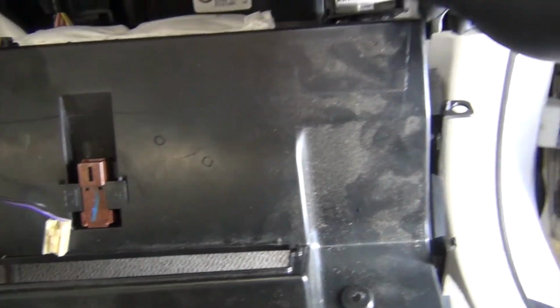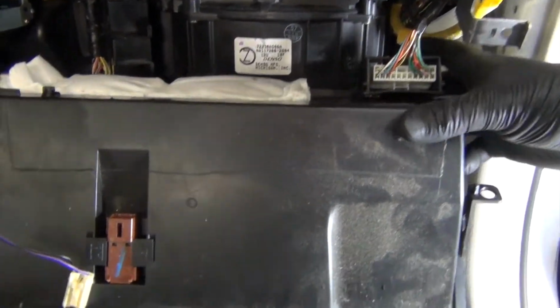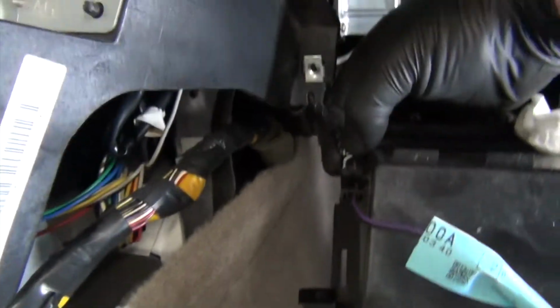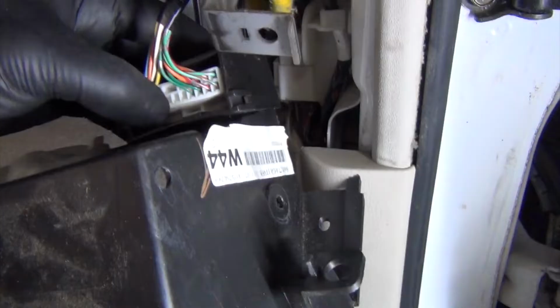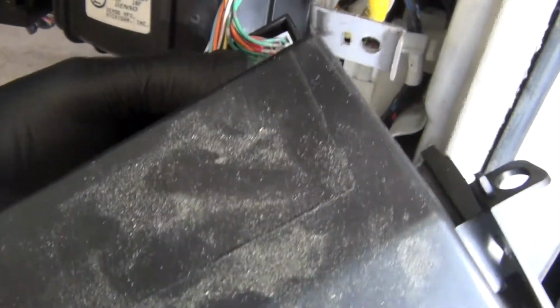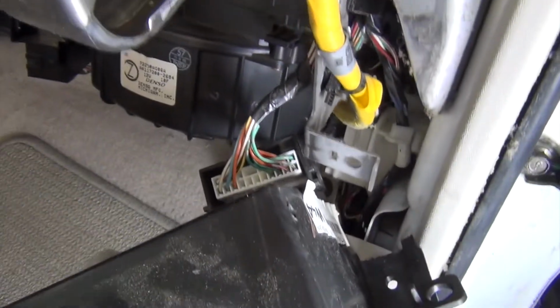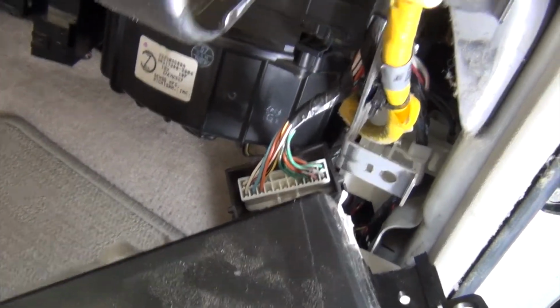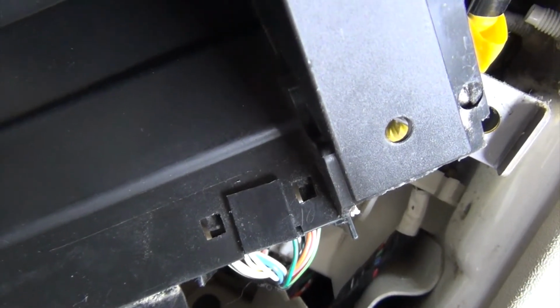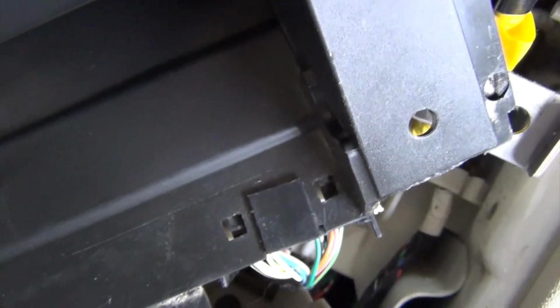So that's out. I'm gonna disconnect the wire harness from the back here and disconnect this guy too. And just wiring harness right back here. That guy's free. And this guy, it's really that this whole plastic thing connects onto the back of the box. So I'm going to use two hands here. And for that bigger clip, you can see this is looking at the underside of it. There are two little clip release points and a center one. So that's how you get it free.